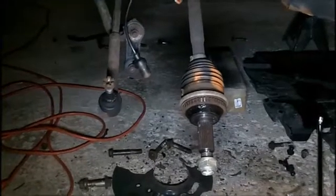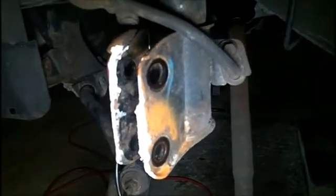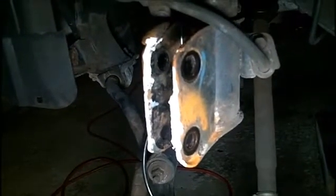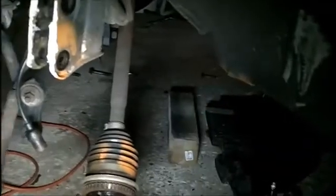First things first, with all the steering stuff, alignment is very, very important. So as you can see on here, I spray painted it with orange spray paint first, and then I went back and tried to hit it up with some whiteout to give it a little bit more definitive line between the connecting piece and this. So I lined those up first. Then I was able to take the top screw's nut off and the bottom.